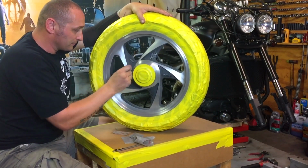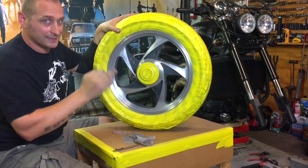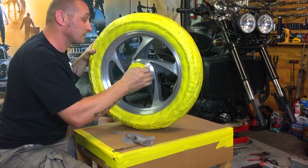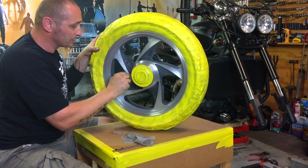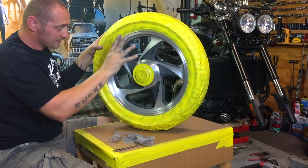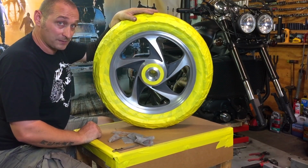I'm just going to do the primer right away, and I try to make the waiting time as short as possible. Even though, like I said, the oxide is already there and it forms in seconds, right away on the surface, if I do it fast, the paint is not going to peel off that soon. Yeah, it's pretty difficult to work with aluminum, but not impossible. So I'm just going to give a little sanding touch-up here and there, look around and check it again everywhere, and then do the primer and the base coat, and then play with that rust effect somehow.